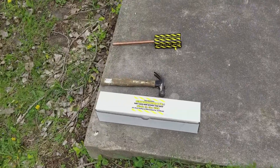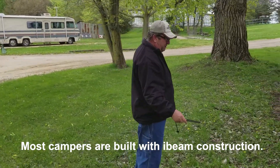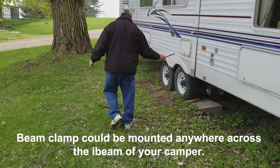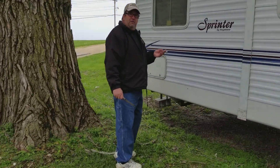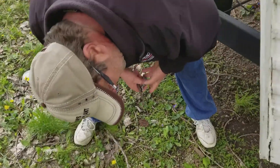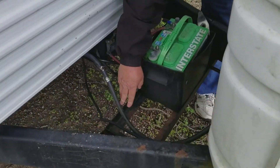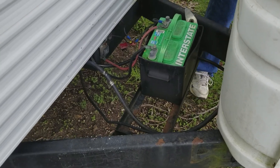Let's talk a little bit about where we're going to put this. Most campers are built with an I-beam construction, so that I-beam runs the length of the camper. You can't see it, but there's a little lip on the frame, so this beam clamp could be mounted anywhere across this camper. You just want to make sure it's connected to the metal frame. We have several locations — there's a little lip right here underneath, and if you walk around on this side, there are lips here, and everything here is all welded to the main frame. So anywhere here is going to work.